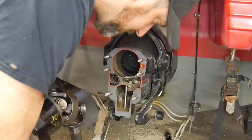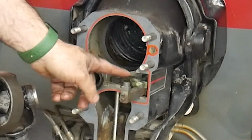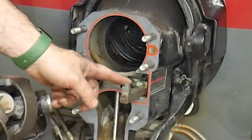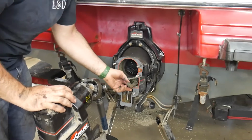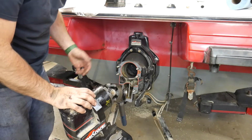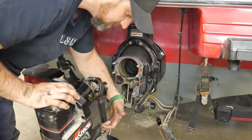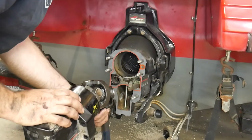You got a lot of things to do. Make sure it's in forward, so you got to make sure before you go and slam this thing in here that this is in the right spot. Make sure your shift mechanism is all in the good spot. This one's nicely greased up, so I'm not going to bother putting any more grease on there. Your shifter is on the bottom here, so make sure it's nice and straight, and it's going to line up with your shifter up here. Make sure that's pushed over and straight.